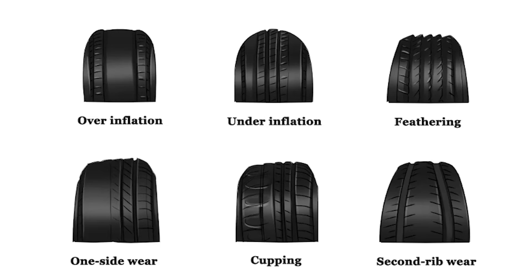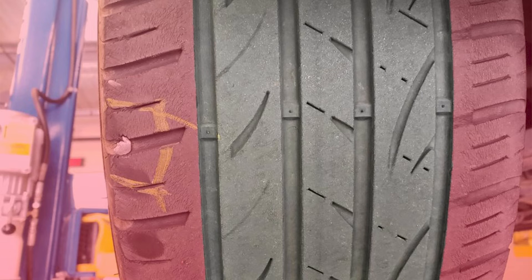Here is a list of common unusual tread wear conditions. During our inspection, if we find any damage or road hazards on the edge or sidewall of the tire, the tire cannot be repaired and will need to be replaced. Generally, any tire that is at or below 2/32nds of an inch will be considered unsafe to drive and should be replaced as well.